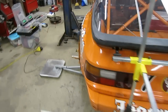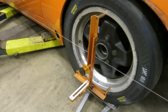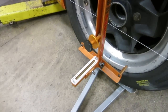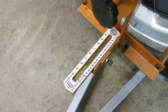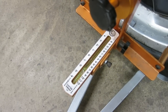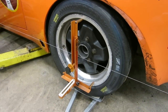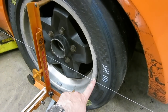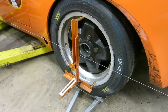For the camber, I have a bubble level camber gauge. It can also measure caster for the front — we don't do caster in the rear. It's got a little bubble on the scale, and right now I have just about negative 2.5 degrees camber on this rear wheel. And again, with a little ruler measuring to the edge of the rim to the string on both sides, I can figure out the toe-in.